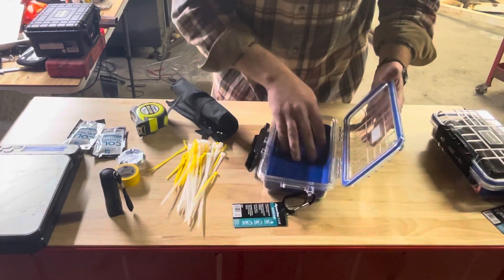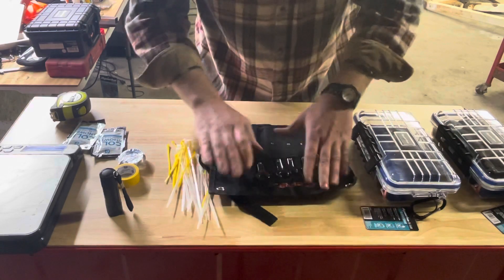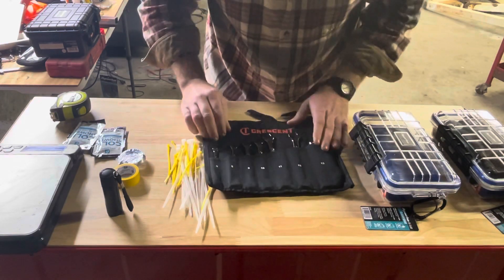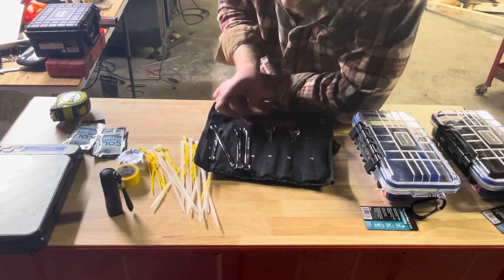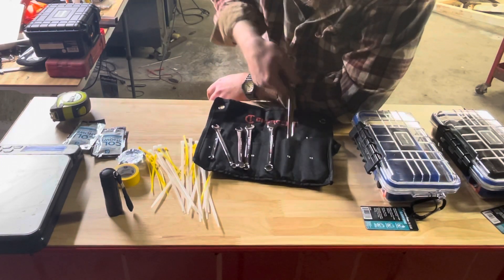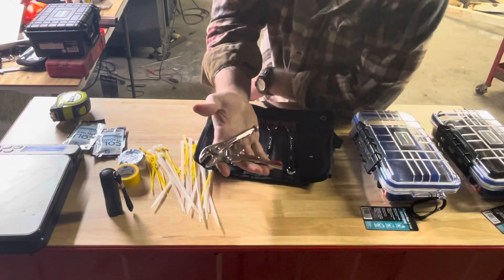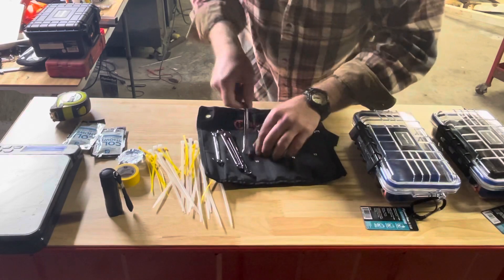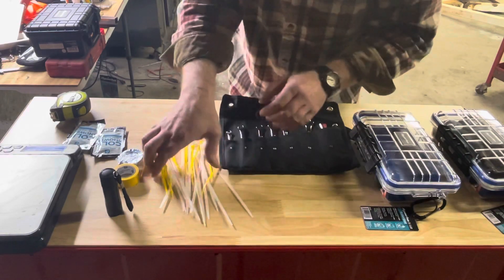This tool roll is catered to our 300L, 250L, and 450L bikes. We've got a nice Crescent tool roll here with a six millimeter, eight, nine, ten — we removed the eleven millimeter since we don't need it for anything on our bike — then a twelve and a thirteen. Removing what we don't need allows us to add a nice locking pliers, which fits great in the thirteen spot. So let's not buy what you don't need — buy what you do need.